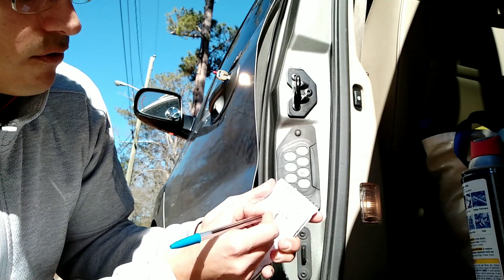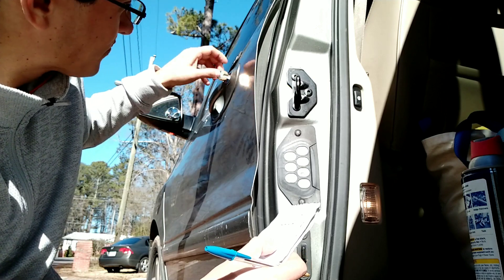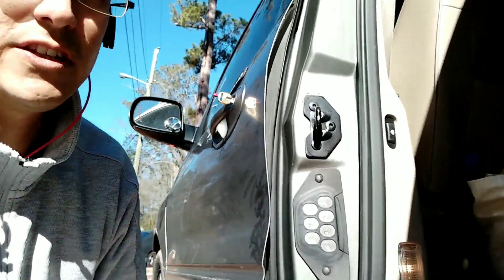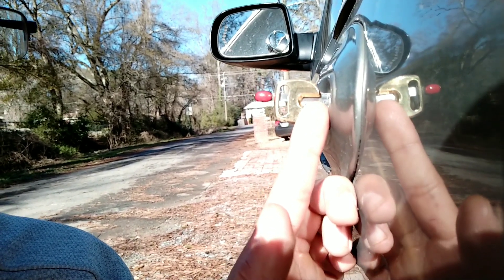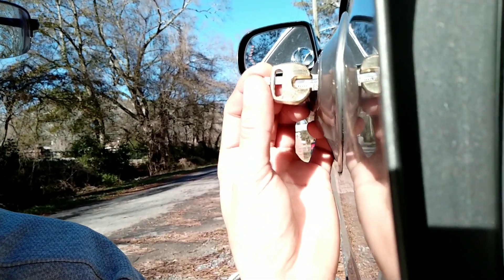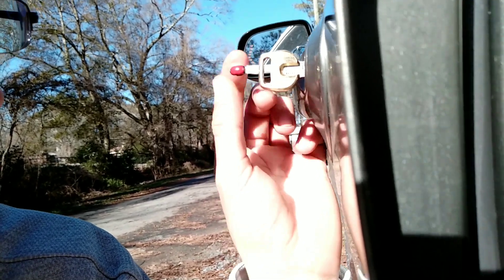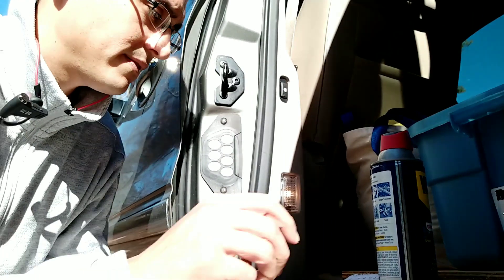There's a total of six cuts we have to read. We'll start with the first cut — you'll see there are little tiny teardrops on this Easy Reader, in between here. It's telling you if the indicator slides on one of these two where the cut is. I slide this reader back and gently push it back. It'll try to tell me where exactly that pin is, and as soon as I feel any sort of resistance, that's when I know that is the right pin. Right now it's lined up with number two, so I'm going to write down number two.